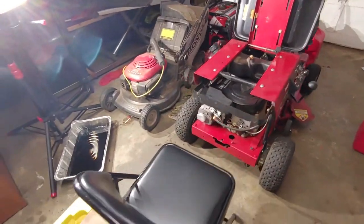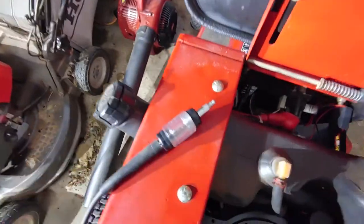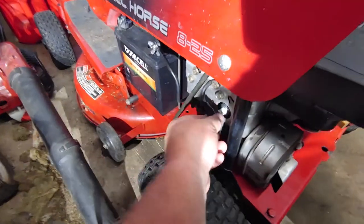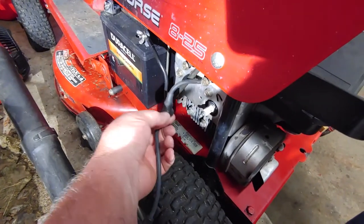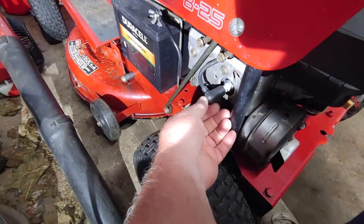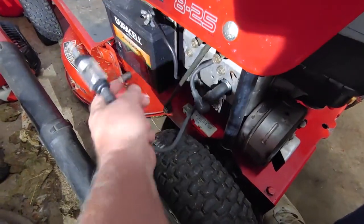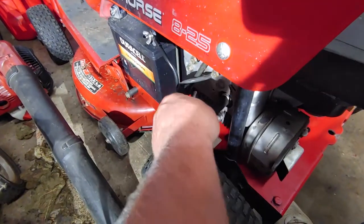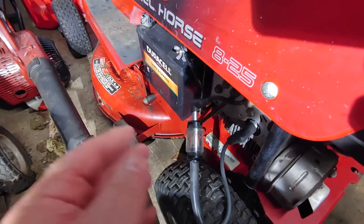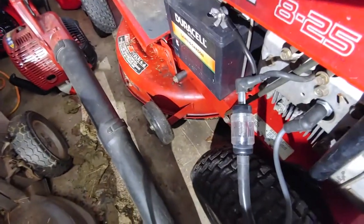Or not again, it would not start up. So I did a spark test, which is taking this inline spark tester, and the way it works is you unplug your spark plug wire, spark tester goes in, and then your spark plug wire, spark plug tester goes into here. So we turn it over,